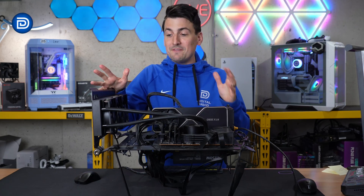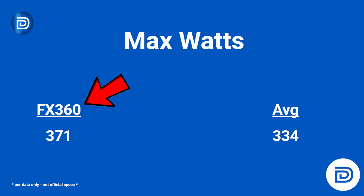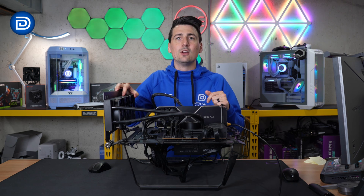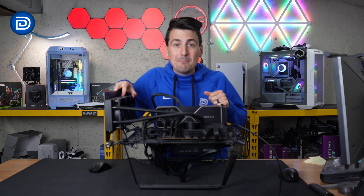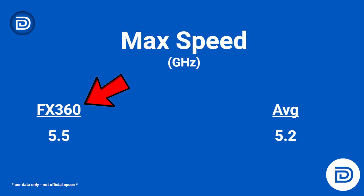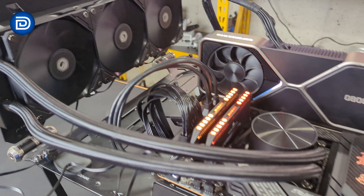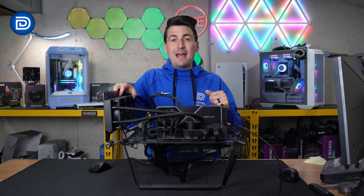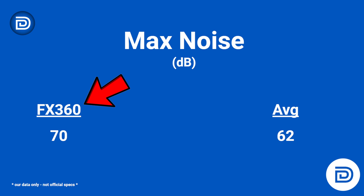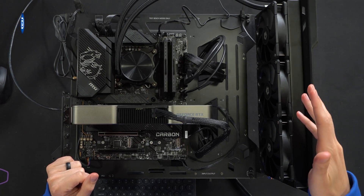In regards to max watts, we've never seen a value this high from this test bench — we peaked at 371 watts with everything wide open, a pretty substantial boost compared to the average of around 334 watts. Max speed hit 5.5 GHz, the highest we've ever seen with this configuration, about 0.3 GHz above average. For noise at idle, we peaked at 48 decibels, with most of that coming from the pump housing rather than the fans, which came in the low 40s. For max noise, we peaked at 70 decibels — about eight decibels above average — so you'll definitely hear this when everything's wide open.